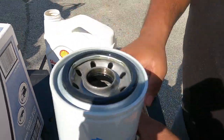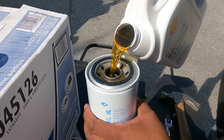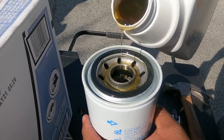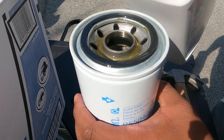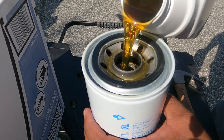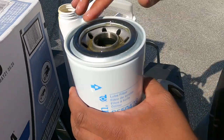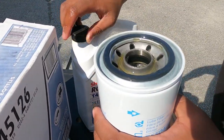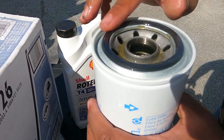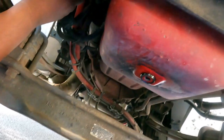I'm gonna fill this filter up with oil - leave about right there, a little bit more. All right, that should be good. One last check all the way around with the gasket - it'll make it easier when you change the oil next time, it'll come right off. Make sure it won't be cracking with the heat either. I'm gonna go ahead and put this back in there - gotta find some room to get up in there.